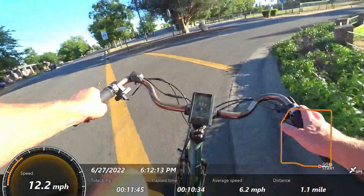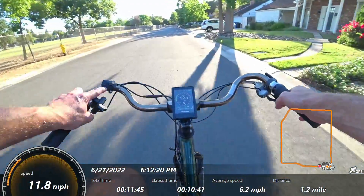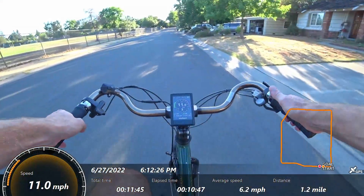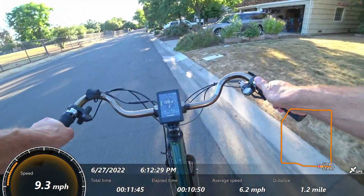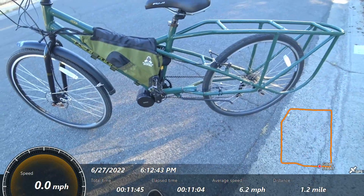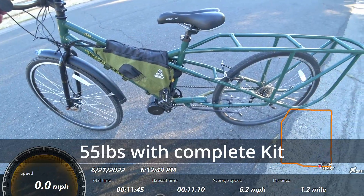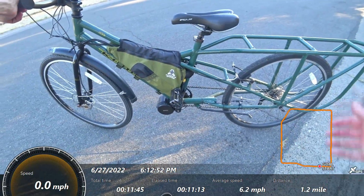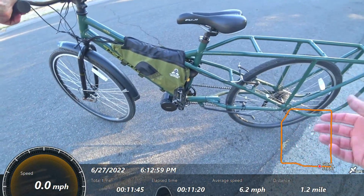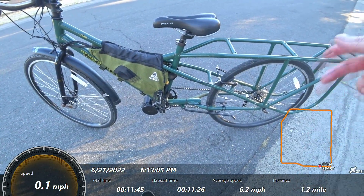I didn't bump the top speed capability in the display all the way up, and I also tend to set my maximum controller output a little lower — a couple amps lower than the recommended maximum. But you can still see that with all that being said, it's still pretty easy to get one of these up to 30 miles per hour — pretty awesome. The final bike weight as it sits is in the mid 50 pound range, so you have an e-bike that's way lower weight, way faster, feels better, more responsive — it's more everything. The only potential downside with a mid-drive is slightly more drivetrain wear and you might have to do some more maintenance on that particular part of the bike.